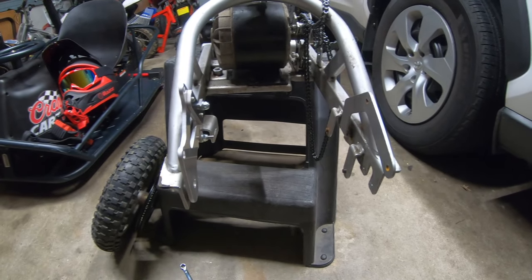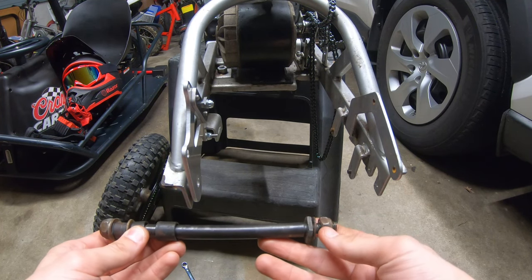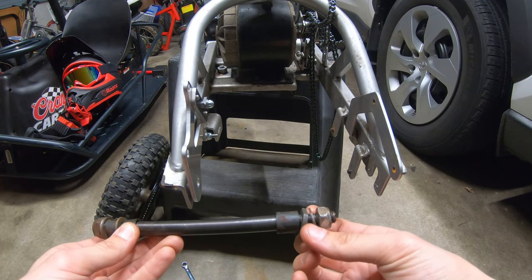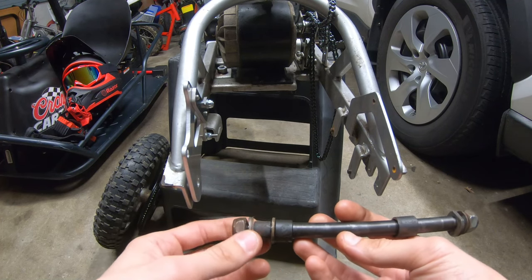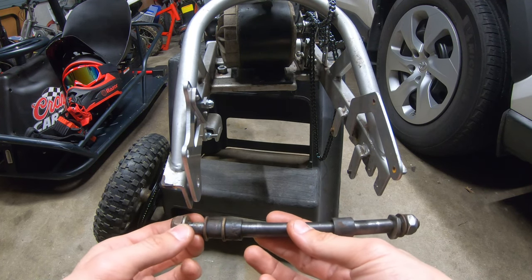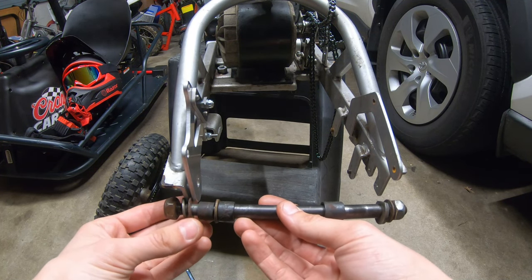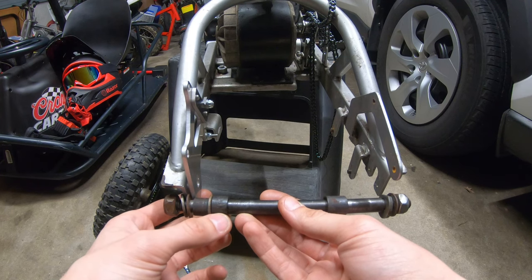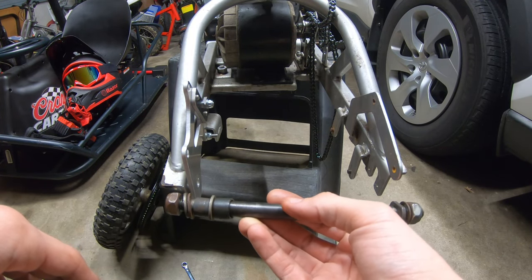So now I wanted to go over the axle spacing as it took me quite a while to figure out. So this is going to be your chain side — you're going to have one spacer over here. This is all stock, so your swing arm will go right in between here. And then on this side, obviously you used to have your drum brake over here. So the spacing that I have figured out is washer and nut on the outside of the swing arm, one washer in between the adapter and the swing arm itself, like so — this small washer, this big washer, and then this big spacer. So that is the best way that I figured out, so we're going to go ahead and get the wheel mounted on there.